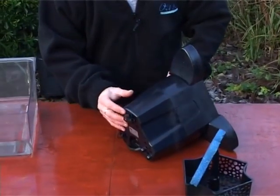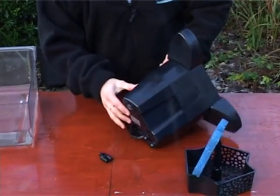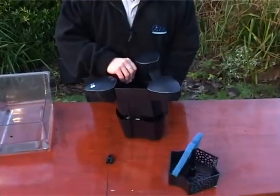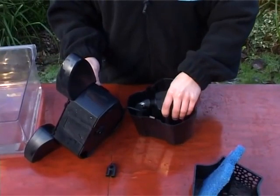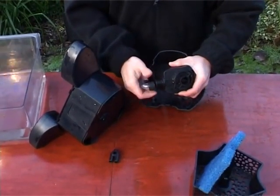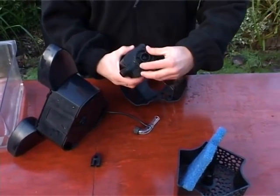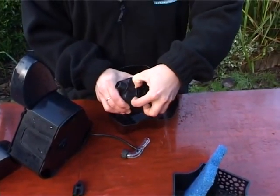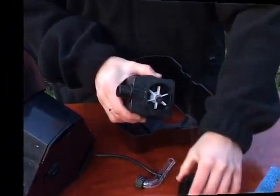For more thorough cleansing, once you've rinsed out the debris collection basket, remove the air distributor from the base, then remove the skimmer base from the top section by pressing in the three sides where indicated. Taking care not to detach the air hose from the injector, remove the pump and unscrew the retaining nut for the injector. Twist off the front pump housing and remove it, then remove the impeller unit by pulling.